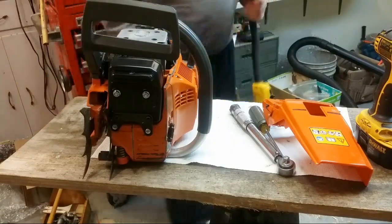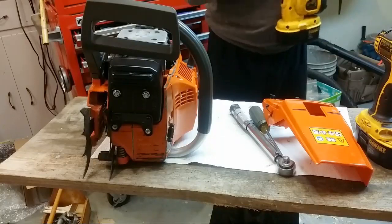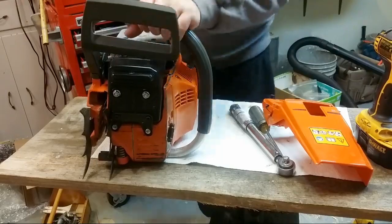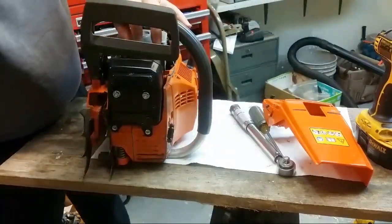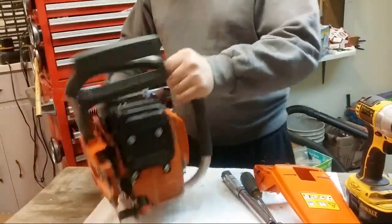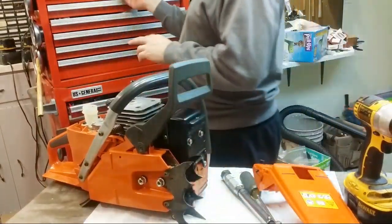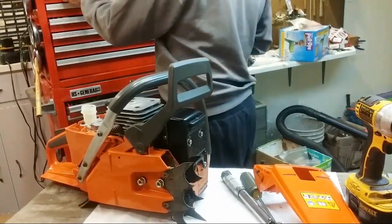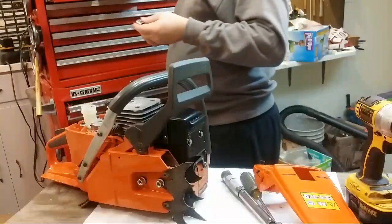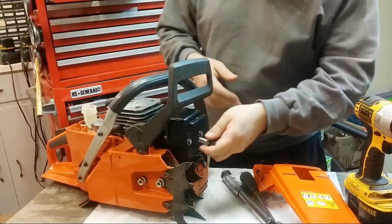So, Brandon, by the time you get done with the 660 kit, making it a good saw, making it reliable and whatnot, you're going to be into it for $500. Probably $500 plus, basically. So, just keep that in mind with the 660 kits. You can build them as they sit, but I think it's better to build them for a little bit more reliability, and so I would definitely do things like the OEM wrist pin and pin bearing.